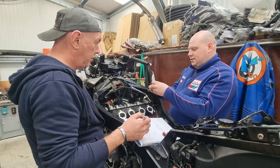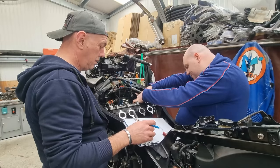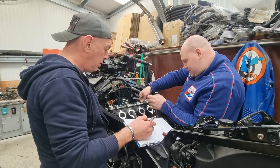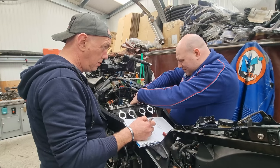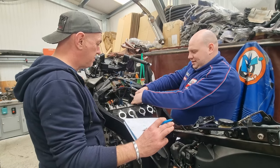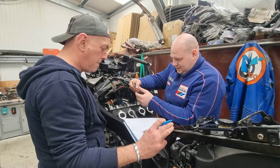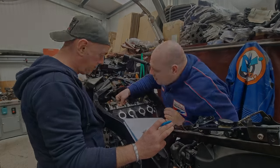Let's try the 0.18 - the 0.18 goes into there. 4.2 - 0.15. 4.1 - 0.18. So he's getting close, it's still within spec. This is why we write it down - if we find the one that goes in, we might find some bring it into spec. So 0.18 goes in there. 0.2 - done. That's 0.18. Number two - let's go back to 0.13, the smallest one. 0.13 goes into that one - oh, that's very loose.